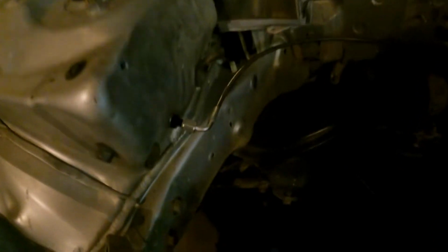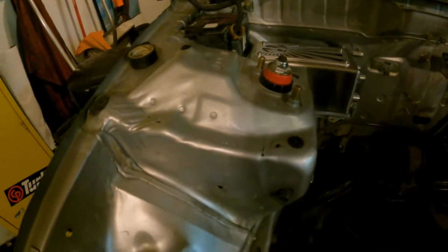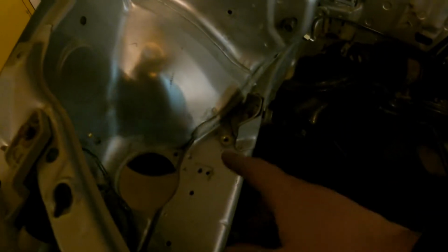And then, I'm on that bracket, I gotta pull that. But you look down here, the headlight harness isn't running down, you know, along the tower here like it is from factory. So, this is basically the same way we did on my black car. Harness comes in here, it just goes right to the back of the headlight. And then all of this excess will get tucked up underneath the core support here. And you'll never even notice the headlight harness sitting there.